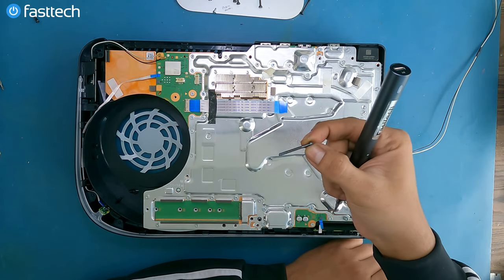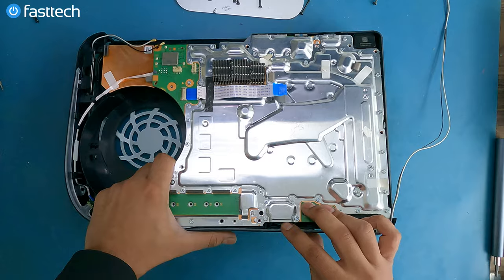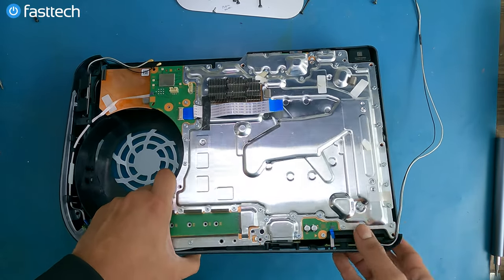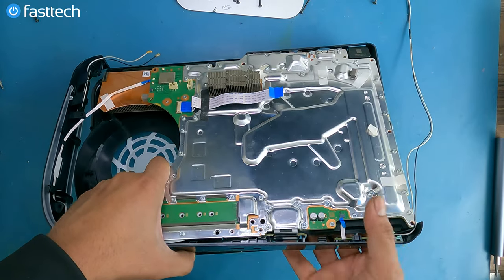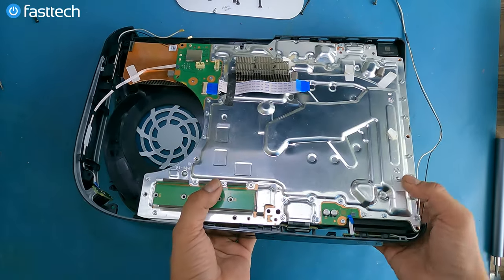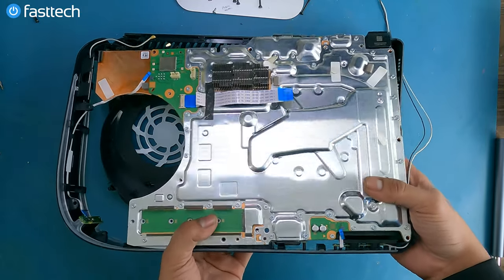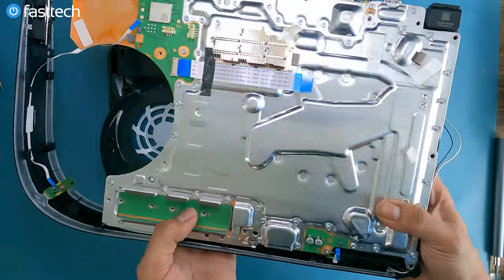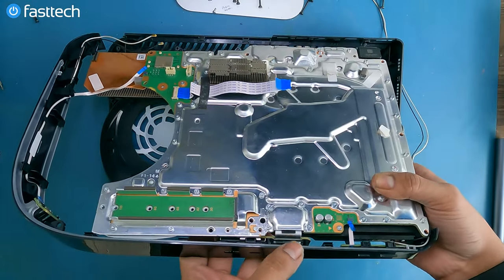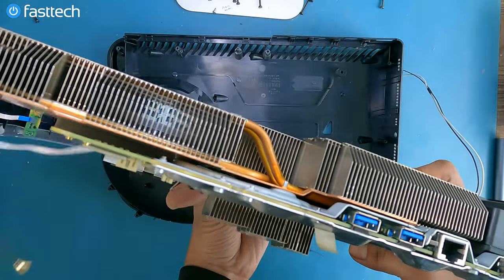It's a tall black screw. There's still one cable for the panel I/O and the power button at the front, so do not cause any flex on this cable. But this is the easiest way to get it out — boom, like this. Now you should be able to simply lift out this entire assembly. I'm holding the power supply in the back as well.